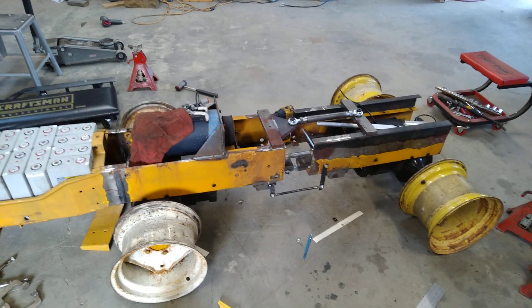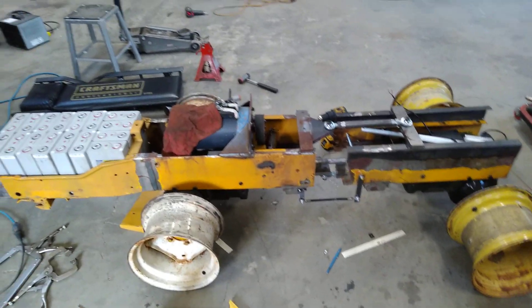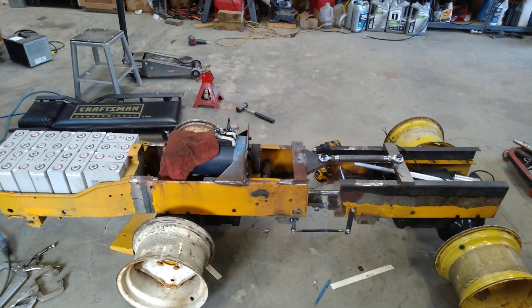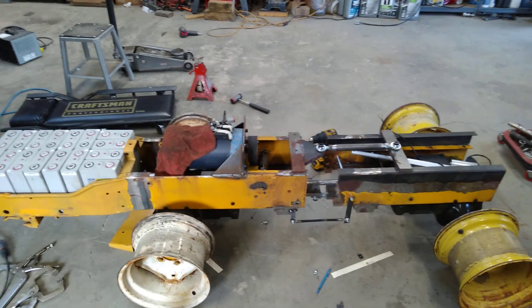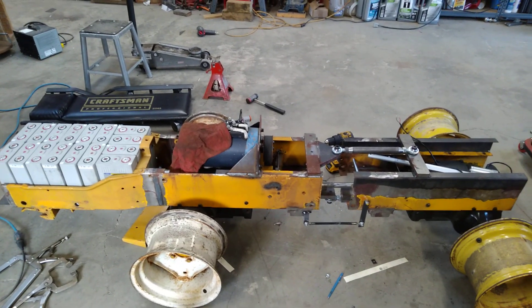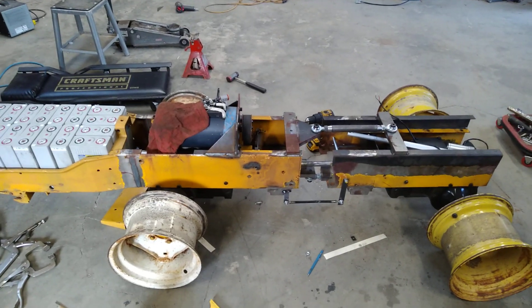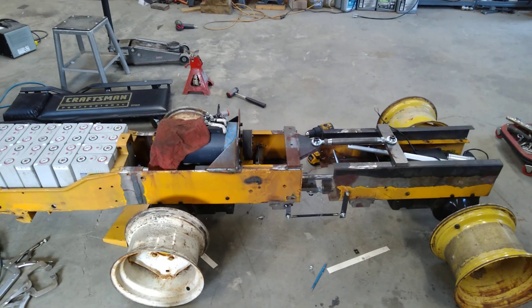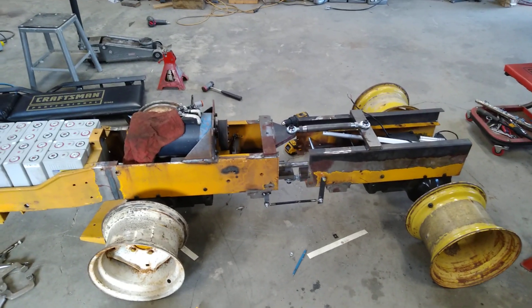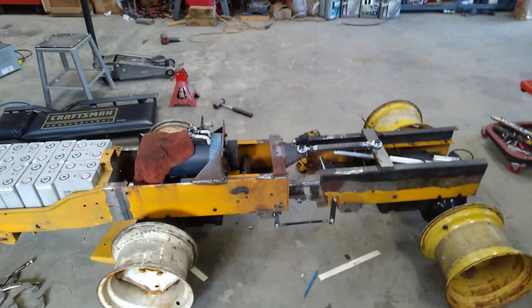What I bring them up for is because they take a different method to building than I do. Their method is: get the donor machine, strip it down to bare metal, put little white dots all over it, and have a company come in with an imaging camera that renders a 3D digital animation of their entire Jeep in naked form on their computer. From that they can design battery boxes, charger placement, motor mounts — and then get prints to send to a company to have parts laser etched or fabricated, and then bolt it all together. In theory it works, and I admire them for doing it that way.